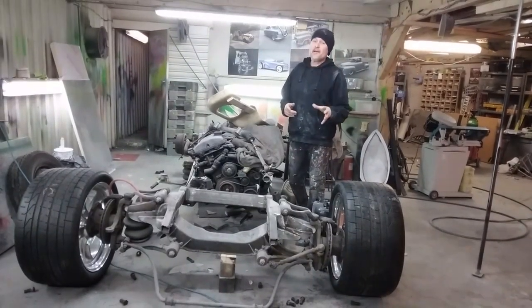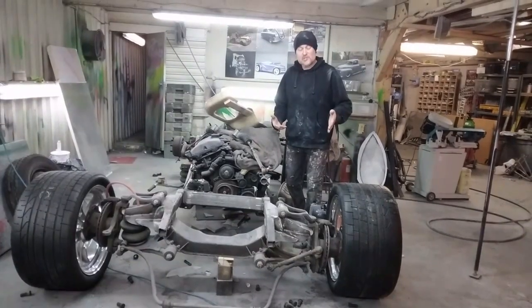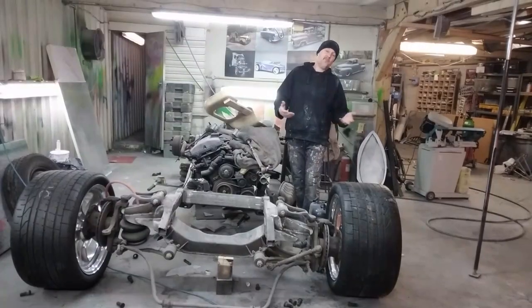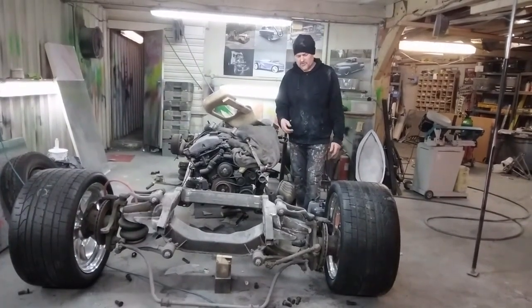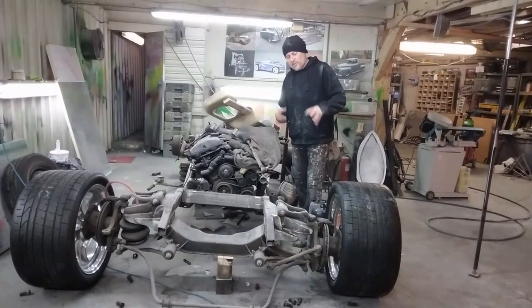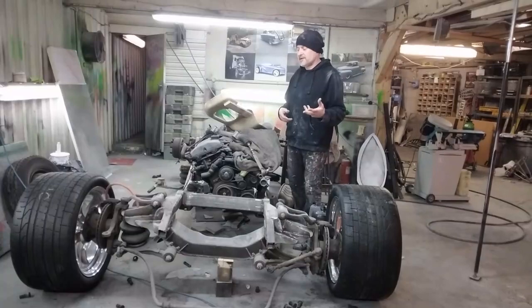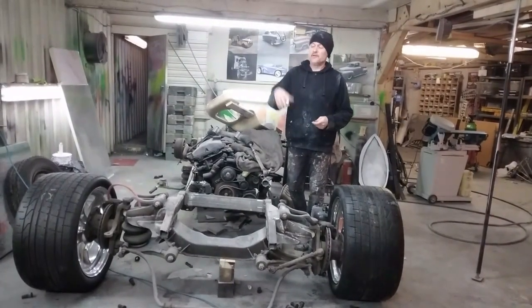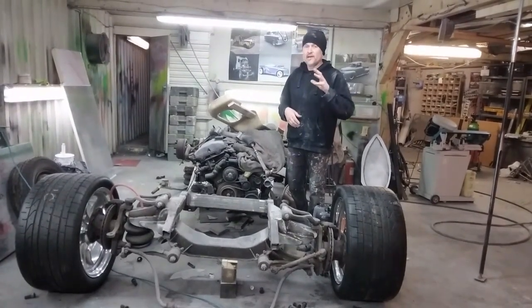Because if you are basing a hot rod on a taxi, there's no options of wheels unless you want Iveco lorry wheels on it, which just look the same as the taxi wheels, funnily enough. But we'll be making those adapters, and we're going to make them so we can make them again. So if you're making a taxi project, we can provide you with 6-stud down to 5-stud Jag Chevy, really easy.